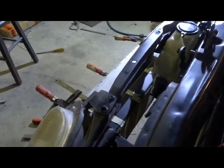Now up under here is going to go the pump, which was a bit of a drama to get in there, but also getting the radiator hoses. As you can see, these hoses, I've drilled one hole really low there, and I've pulled the other one over the top to come around the corner, so I'm going to have to use all those elbows. But inside here it's a little bit squashed. Had to cut all the bottom of the battery tray to bring it around through there. So as you can see, it's coming down there, through there, in past the other radiator, around the side, in behind the headlight. That should clear all the headlight. Bring it into the inside here, and then it'll have some elbows into the water pump, across to the radiator, and then we can just bleed it all up.